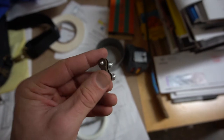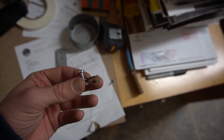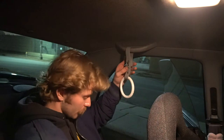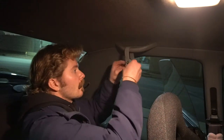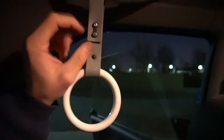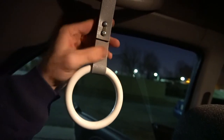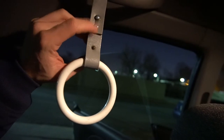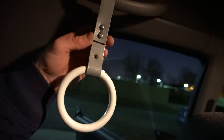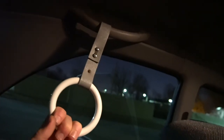I drilled and tapped the linkage for an M4 by 0.7 thread pitch. Now let's go put this on the car. Goes in nicely — throw this over the top, press these bolts through — perfect. Interestingly, the old bolts were brass and so are these plates. Now I have stainless screws, so I'm going to patina them a bit using something in my dad's shop so it'll all look like it came together. There you go — the last thing on there: a genuine Tsurikawa.